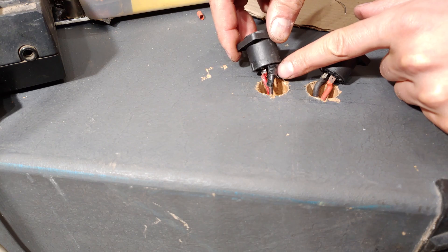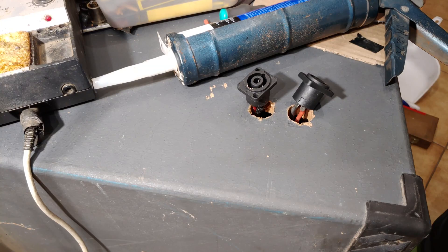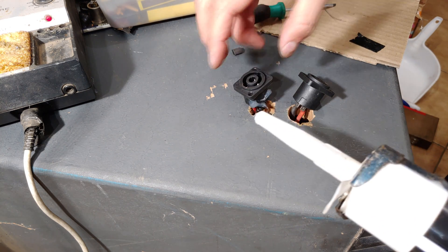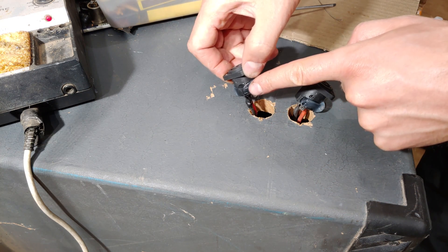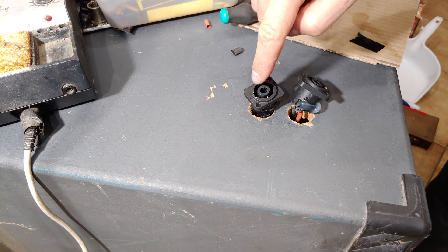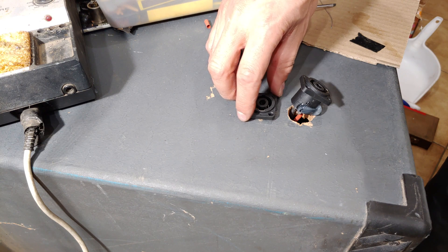The other side just uses tape — obviously that's not the best way; best is heat shrink. Now all you need to do is put these back in, but remember sometimes air can come out here. If it's a ported box it's not a problem; if it's a sealed box you might want to put a little silicone here. I've got some silicone and I'm just putting a little bit here, there, and here, and mushing it with my finger. Push it towards the bottom. Now check your wiring — you can see that tab there with the little arrow telling you the positive wire. Check it's correct, and there you can see the silicone. Be very careful because it actually puts itself on the wood, so you're going to have to screw that in almost immediately and then wipe it off with a cloth.